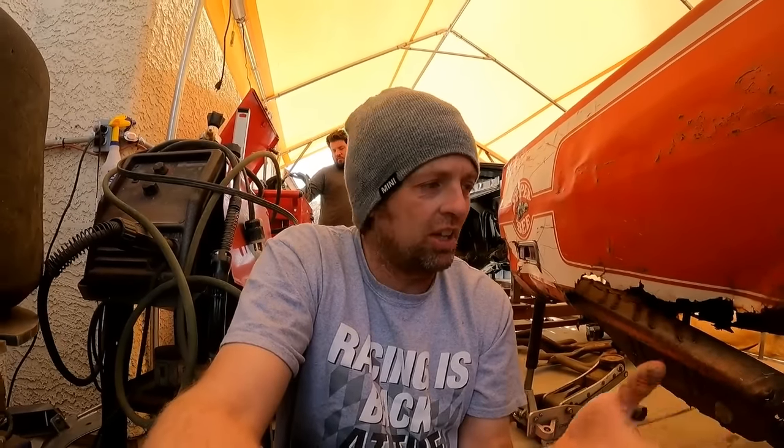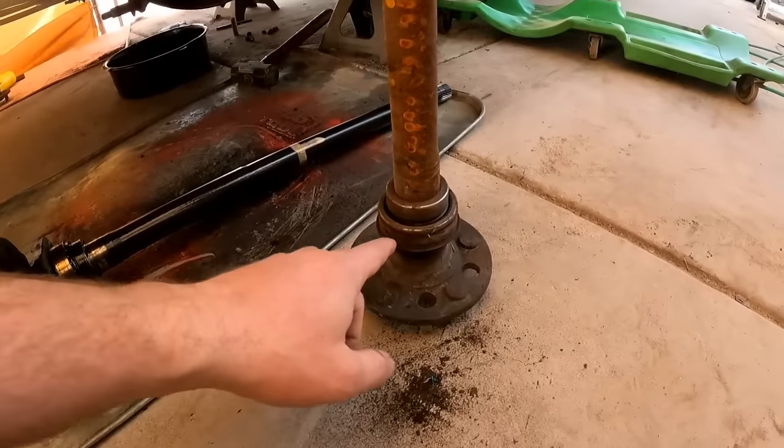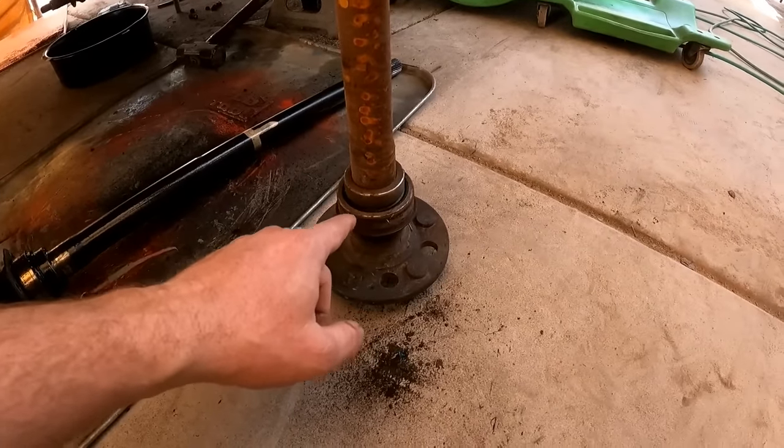So you'll take an extra 5 to 10 minutes adjusting your preload if you pull the axles in or out, or change the bearing. You won't change the bearing because they're never going to fail as long as you keep grease in it. And that's another thing. These are sealed and there's not a lot of grease inside there. You can at least change the grease inside the roller taper bearings. But yeah, that's really the only downfall with the taper bearings: you have to adjust it every now and then. So, big whoop. I would rather adjust something than have something fail.